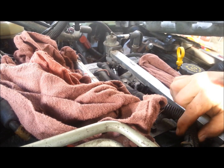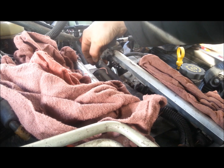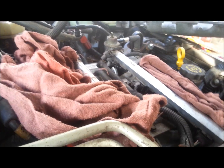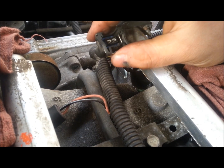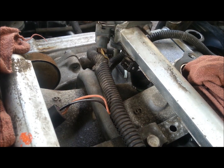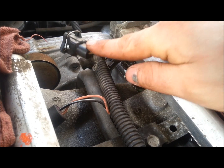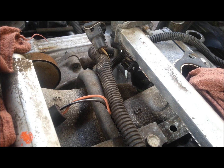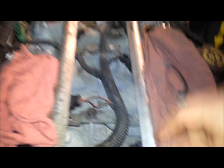Alright, so I'm simply going to look at the injector harness — and as you see, we had an injector that was actually unplugged. So that was unfortunate — I had to go through all that work just to get to that injector open circuit. Yeah, so there was our misfire Cylinder 6 issue. Kind of really sucks to go this deep into getting it, but we figured it out. So now that we've figured out our problem with injector number 6 coming loose — that was where our injector 6 misfire and open circuit were coming from.